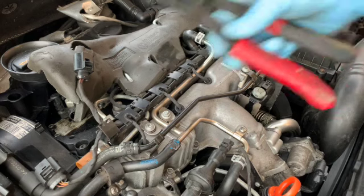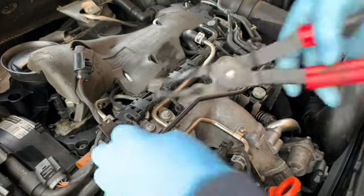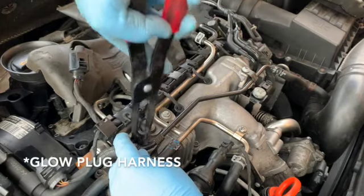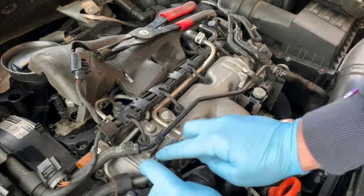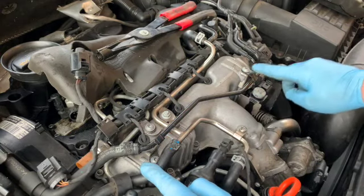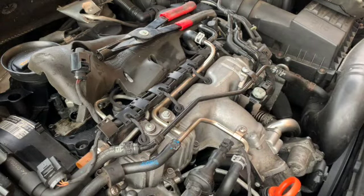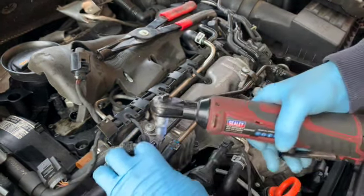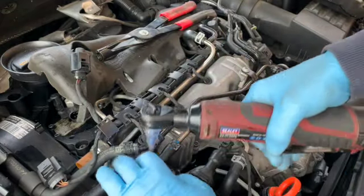What I've got is just a set of old brake pin pliers, which just makes pulling up the connectors easier. There's also a torx bit - there's one there just holding this coolant pipe on, so I'm just going to remove that just to make my life a little bit easier. I think it's going to be a T30 - yeah it is - and I'll undo it instead of doing it up, that'll probably help.